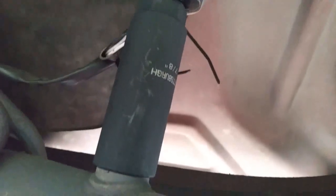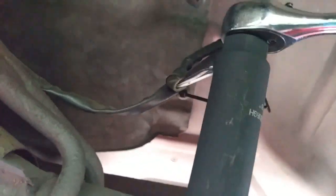For the first step we just remove this cable — it's got like a little clamp, just press right here and it should come out. Once you disconnect that, you want to get a special socket that has a little hole so you can slip it in and mount it on the O2 sensor. Once you've got the socket in there, just turn. I need both hands on this.